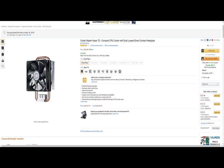So I went with this — it was cheap. It's got a 92mm fan and two copper heat pipes, which when they come down on the bottom, there are four points of contact that pull heat away from the CPU. It uses a loop design where the two copper pipes are in a continuous loop as opposed to having them end off. It could very well have been a cost-saving measure, but they use it as a selling point, and I think it's okay. It supports both AMD and Intel.